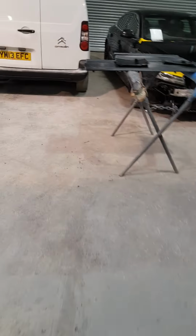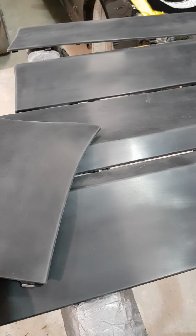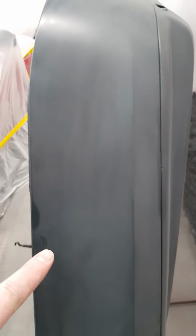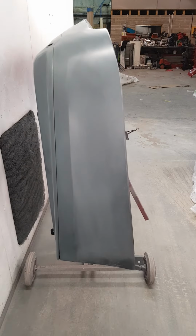So again, these are the plastic door moldings that run down the side of the vehicle. The three pieces, you can see the shine's been taken off with the Scotch pad. Pretty quick, good. It's actually quite good quality stuff. Rear bumper, it's going to be two-tone, so this section here is going to be gloss black, and then this section is going to be the Firenze red, like the car. Again, all grey Scotch-Brited, ready to go. So what I'll do is panel wipe this down and just paint over the edges with the red. There's no sense in painting the whole bumper red, it's basically a waste of paint, and once you're doing a high volume of paint, it matters, it costs.